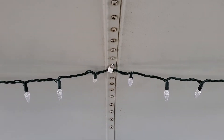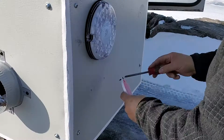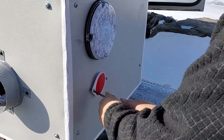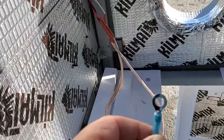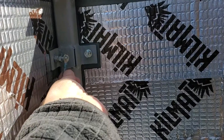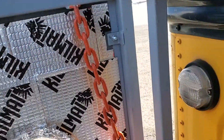I need some more sheet metal screws to hold the reflector in place — wherever will I find some. I'm going to attach the ground lead of the backup light to one of the bolts back here, and I have to dress the other cable to go around the perimeter of the cage.